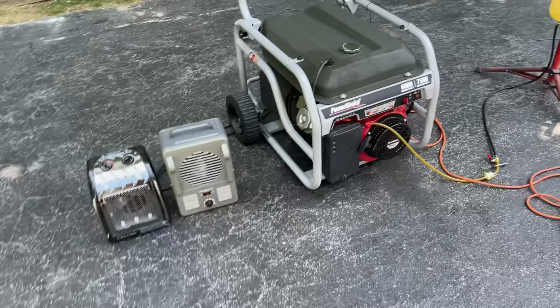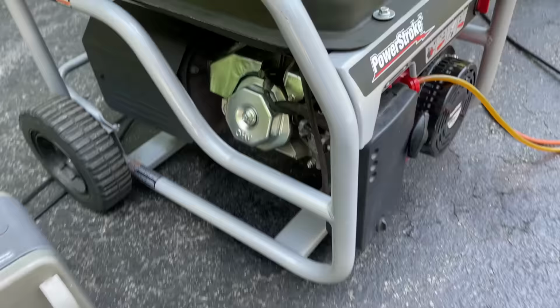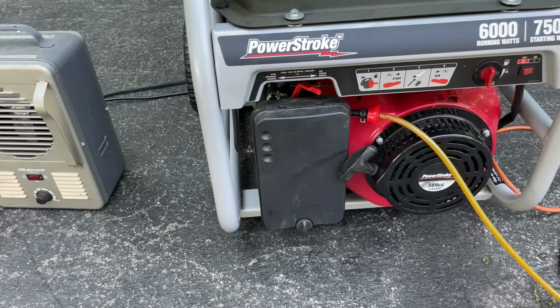That was much better. The fuel leak seems to be a thing of the past, and that's not too uncommon, especially after you clean a carburetor and put it back together. Things sometimes just aren't centered right. And sometimes, too, the solution I use can cause things to stick. Not to mention that carburetor was a complete mess when we started.